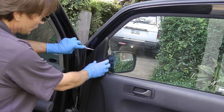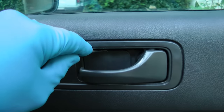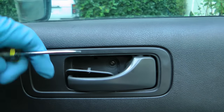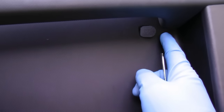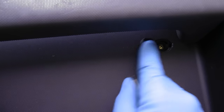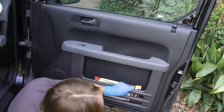So we'll get a screwdriver and start popping off the panels. These door panels are often like Chinese jigsaw puzzles — you get enough little screwdrivers and pry and pop the secret parts off. Where the door handle is, you pop this little cover off and there's a screw inside you take off. Under the armrest there's another little secret part — you take that off and take that bolt off.